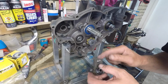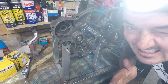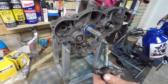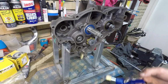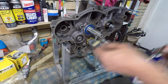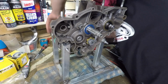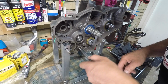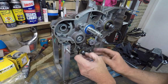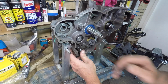So I'll just slide this through. If you can remember, I actually have to attach a gasket to this before this goes into the engine case. Actually, before I do, what am I doing? Just throw it in there dry, like a bloody barbarian. There's another bearing, the same on the other side. I'll just give that a bit of loving. This was one of the seals that I did as a first process, and it was beneficial. I'll do that again. I think I made the right call there, doing those seals first.